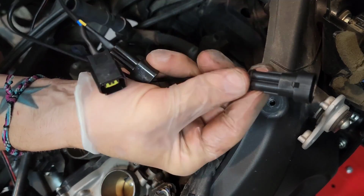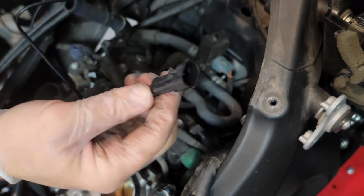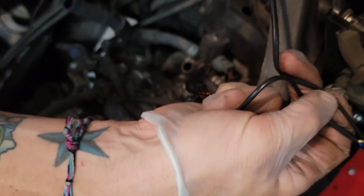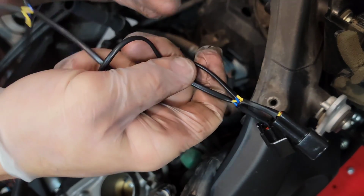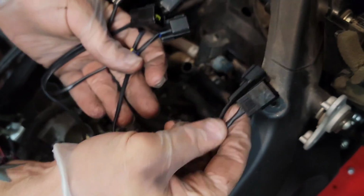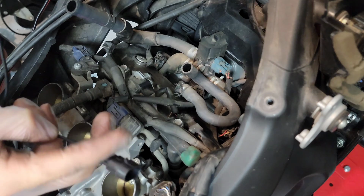And then you have a lead connected to that same harness, which is going to be the one connecting to the quickshifter. Since I'm going to be running the cabling on the left side of the bike, I'm going to use this one as the right piston, then the one in the middle, and then the one on the left, and then connecting this to the other side, and we can start putting everything back together.